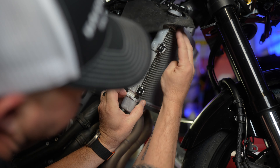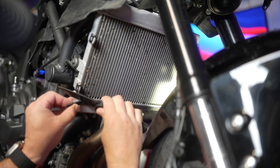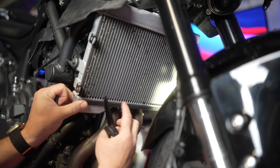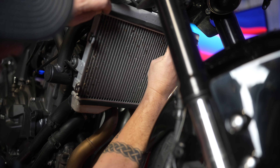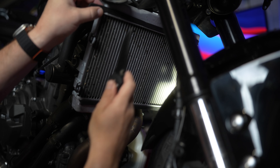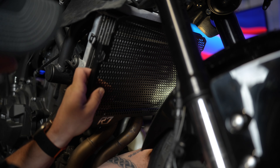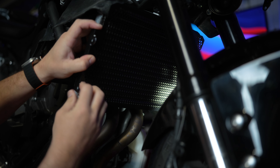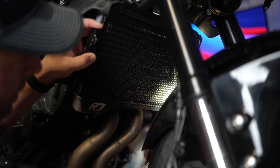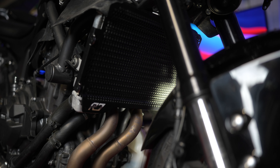We'll install the radiator guard so that it's sitting up against the pad and not the radiator itself — top and bottom, just under this little lip. Once it's on, the top doesn't even really touch up here, but besides keeping the radiator from being scratched up and potentially wearing a hole, it's going to keep the thing from rattling. Now that I've bent these brackets out and installed them, it's much easier to get the guard lined up. No way for it to really rattle once we get these bolts in. I actually think it looks nice too.